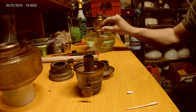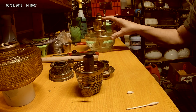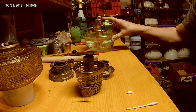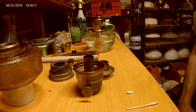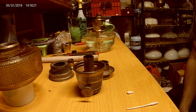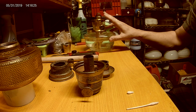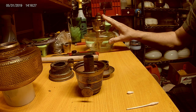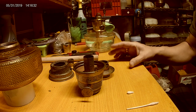This lamp here is a new-style Max Bright 500. This one's been kind of funny for me - I have three or four of these I use. I'm keeping an eye on it, but I'd like to show you the anatomy of an Aladdin burner and what to look for before you put a wick in it. This one appears to be fine; the wick is a little burnt and uneven, so I'm going to trim it and show you how to do that.